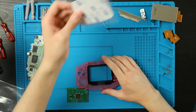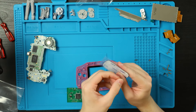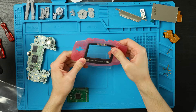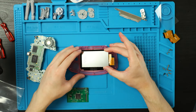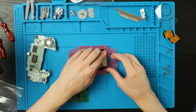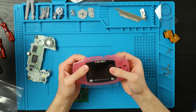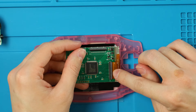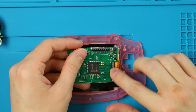Before we put the screen in, place the screen lens on first. We're going to do this very quickly to get as little dust as possible between the screen and the lens. Once we peel the protective film, grab it by the edges, and place it down in the hole. Then peel the protective film off the IPS screen, orient it correctly, and push it all the way down against that acrylic piece — it should fit very tightly between the sides. Now take the motherboard and slide it in so that the white line lines up with the connector, then lock down the connector — it folds down away from the ribbon cable.